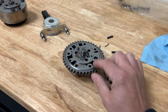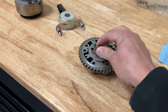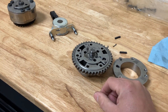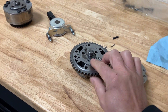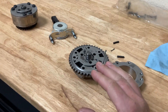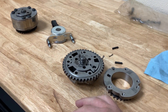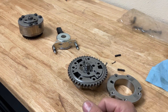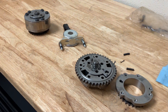Higher volume is great if you have loose bearing clearances — you can get more oil in there. Pressure can be higher as well. Each pump has a pressure bleed. Pressure is necessary — the higher the pressure you have here, the more this is going to be locked. So it can handle stiffer valve springs. Low pressure — that's no good, you're going to lose control. Stiff valve springs with high pressure: you've got good control. You can run a higher viscosity to minimize the bleed between these pieces. But if you pump it all to the top of the engine and the oil pump is just picking up oil and air foam, it doesn't matter what oil you run — it's going to pump air through the engine and this won't work like it's supposed to.